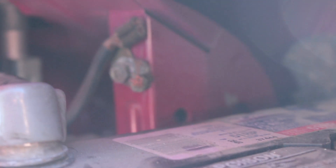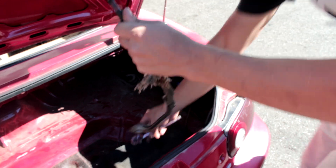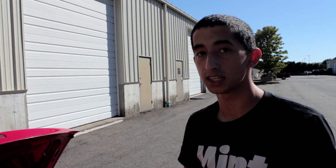Right back there you can see where the ground broke, and here's the ground cable right here. To start it, I had to put the negative terminal onto the negative — he touched them together and said start it, and it worked. The alternator was keeping the charge. We popped that off, reattached it, re-bolted it back on, and his car's all set.